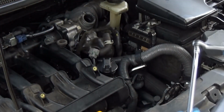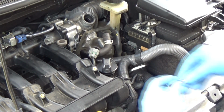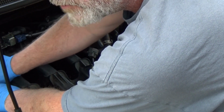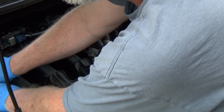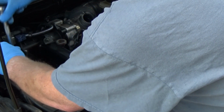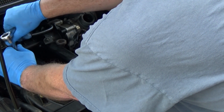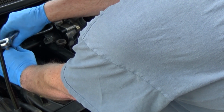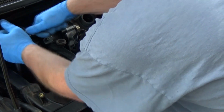I can't believe that the spark plug broke in half like that. You know, often there's many signs. It's not just one that points you in the direction of what the problem is. You'll see a number of things, generally speaking. But right now, with that compression being as low as it is, I'm essentially running on 3 1/2 cylinders. That explains why I have a loss of power. It explains a lot of stuff, my gas mileage not being so great anymore.